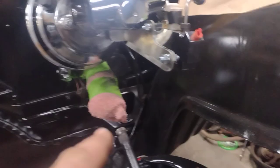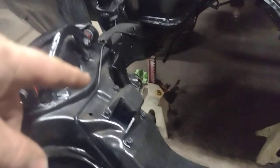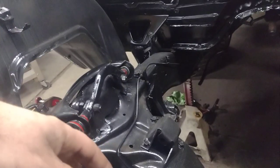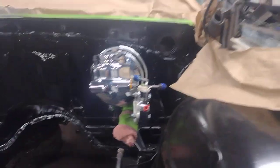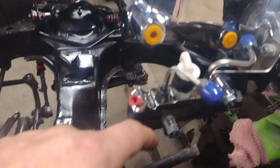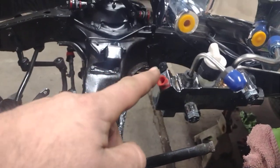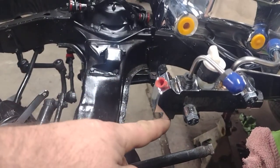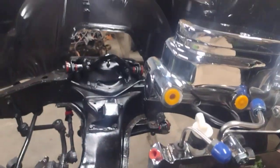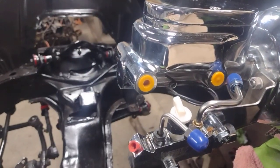Anyway, that's where we're at. Gotta run the brake lines a little differently. This was drum brakes, and it's just one brake line that comes down, T's for the front wheel, comes across, T's for the other front wheel, and then goes back to the rear. With the way this proportioning valve is set up on the new brakes, it's got two front outlets — this one here and this one here.